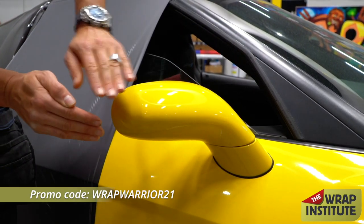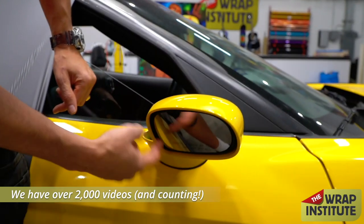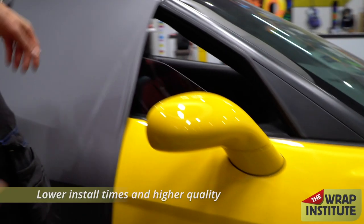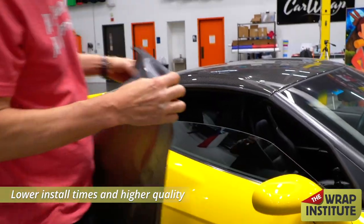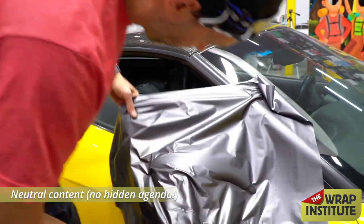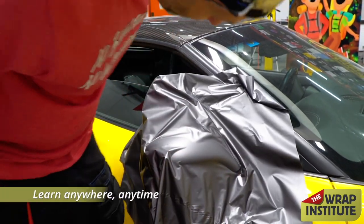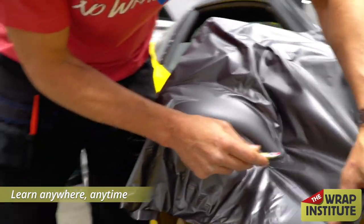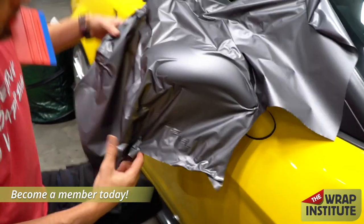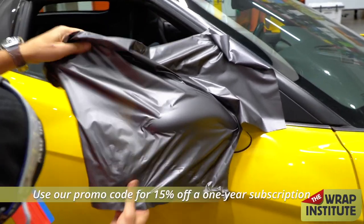On the top back side there are lots of mouths on the inside, so by working the compound curves there will be lots of wrinkles in the middle — but that's actually good because those mouths are hungry for material. I start at the 50/50 point, which for full mirror coverage is right on this back section, keeping tension nice and even on the front section. Once anchored I make a U-type cut at the front, which lets me relax the material on either side — that relief cut is very critical. I spread the material out and see a massive amount of wrinkles, but that's okay.